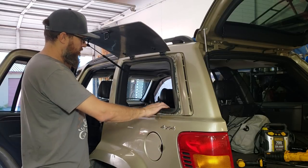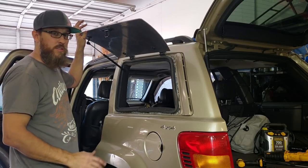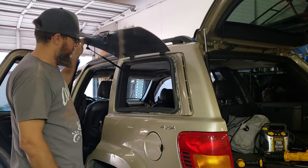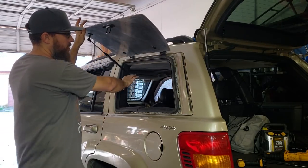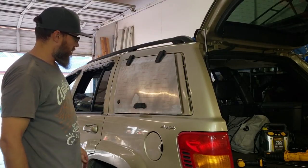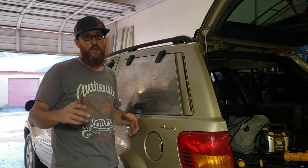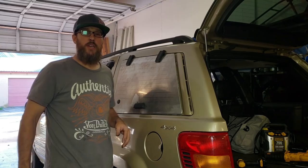The seal worked great. The trim worked great. The single hinge — this strut's no good right now, so that's why I'm holding it up, I've got to order some new struts — but I think just a single strut will work great. It's really light. The alignment of the hinges wasn't an issue. I have a little bit of planishing left to do on this panel — there's a big dip right in here I've got to work on. But other than that, I think the idea is pretty sweet. You know, when you're out camping, pop that baby open. Hope you enjoyed this — please like and subscribe to my channel. Any feedback or comments, let me know — I can either explain it or maybe you have a better way to do it. Keep checking back for more. Peace out.